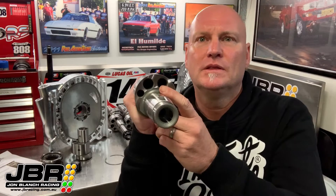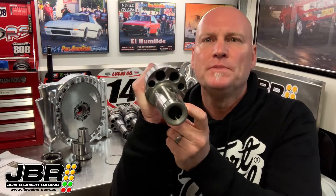Next thing — if you look here at the holes drilled into the rotor journals, those who are familiar with what a factory shaft looks like will notice they're a bit different in size to a standard shaft. This means that the weight of the journals is different, which in turn means that the rotating assembly has to be balanced totally differently to how you would balance a standard assembly.